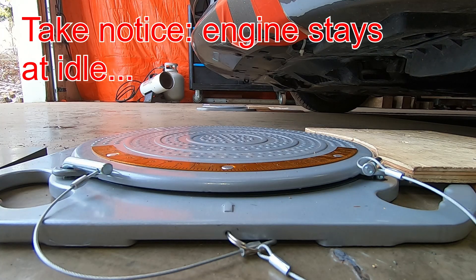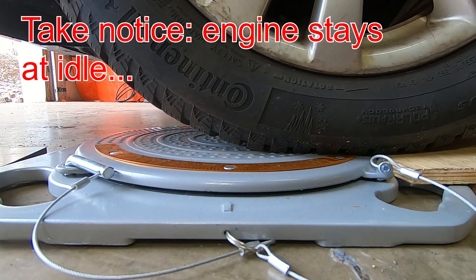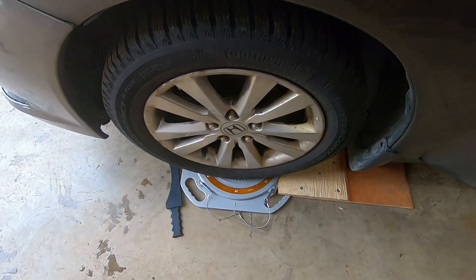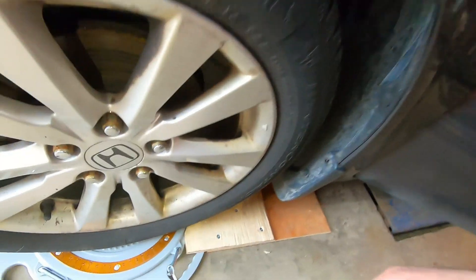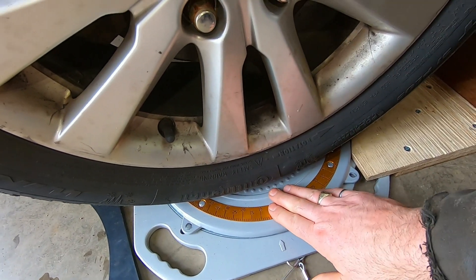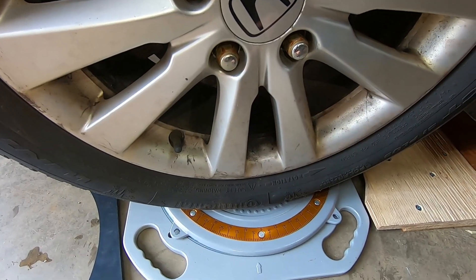So there we are, centered. I didn't actually have to touch the gas at all — just putting it in drive at a fast idle was enough to roll up, and there are the two wheel chocks. Once you're in place, pull the pins out and you'll notice the plate shift a little — that's totally okay, it's designed to do that, and you're free to perform your caster measurement. So that's an overview of how to do wheel alignments in your own garage. You can do it yourself. If you like my video, subscribe — I do all kinds of stuff like this.